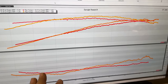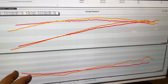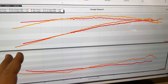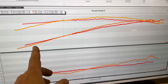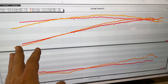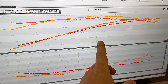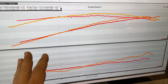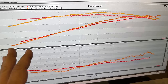But once I hopped out of the car and it was warmed up, I did have to adjust some things on the car because it was knocking at idle because we're so lean now at idle. So I'm tempted to leave things the way they are right now. We will need a needle change if we want to make this any better down here. We're just losing a little bit between 2,000 and 2,500 RPM. I shouldn't really be there on the racetrack, and we're at the same or better as we were with the HS2s. So I think we've met that middle ground mark where these are now better than what I was working with last week, and everything should be far better than it was when I was last on track.